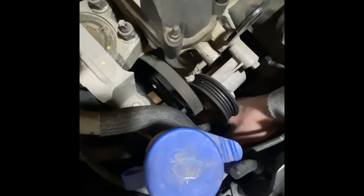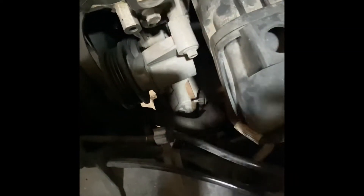We're going to take the belt off the alternator and continue by removing this nut on top of this stud right here. If that's not possible, another YouTuber by the name of Falcon's Garage ended up taking a 5 mil and taking the stud completely out once the nut was out, to help with the removal so you don't have to shift it forward as much.